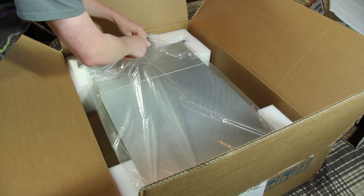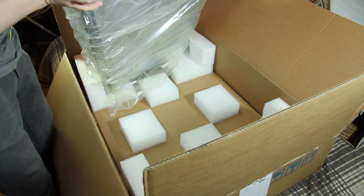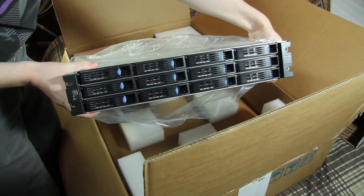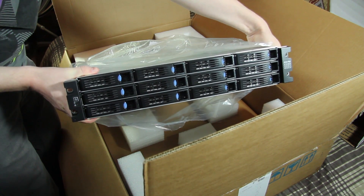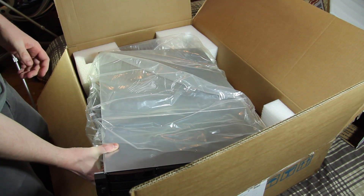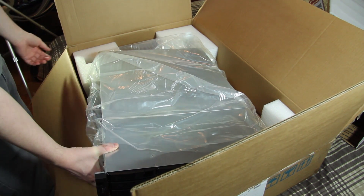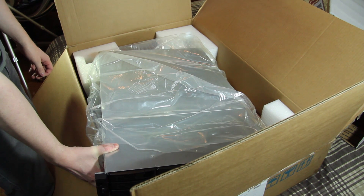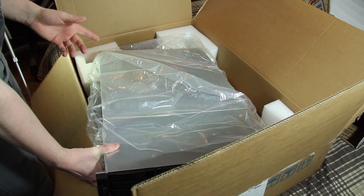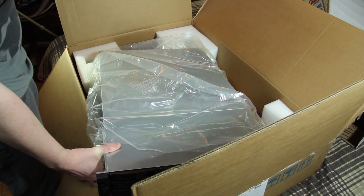Let me get this out so you guys can see it. There's the front — it's got 12 SATA/SAS drive trays and a black backplane, which has three mini-SAS connectors on the back, so each one covers four drive bays. I only have the 8i RAID card right now, but I'll have to pick up another one — maybe a 4i — to do the last four. The plan for storage is to have it expandable so I can add drives later.